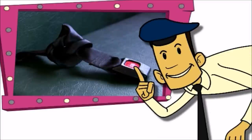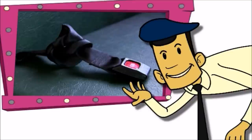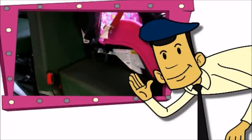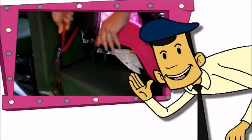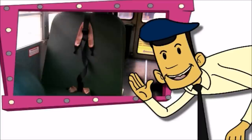That is dangerous. Any attempt to shorten or modify a belt could weaken it and cause serious injury. The entire seat belt should be removed and a new one of the proper length should be installed. Here's a seat belt that's ready to use. See how the non-adjustable part is nice and short? The buckle remains accessible and allows the belt to be pulled tightly out of the belt path.